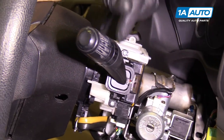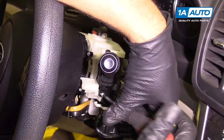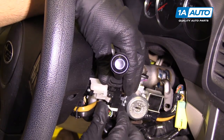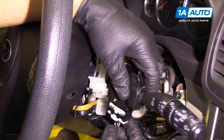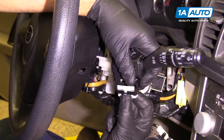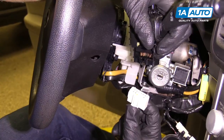We're going to take these two Phillips head screws out. Pull that one out, and you can grab it and slide it. Once it's out, it's easier to pop the connector off here — just push down on this tab and slide it out.